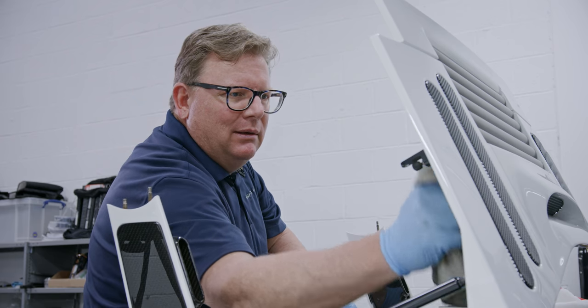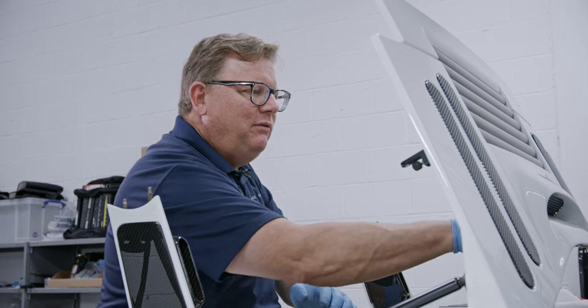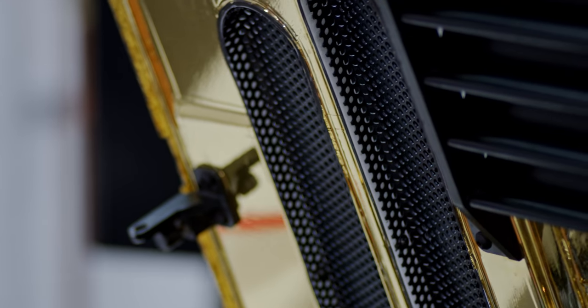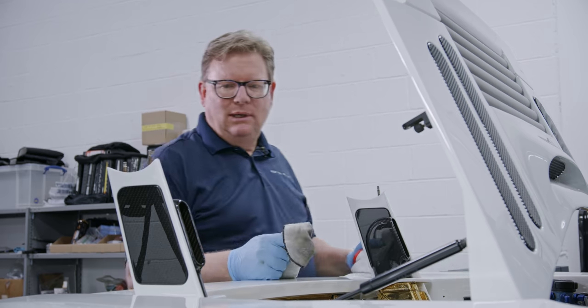The screens themselves are anodized black, so they take a different finish. You can use the metal detailer on them, but they're not painted. If you get a chip in one, it makes a very difficult thing to repair. I've got a special formulated lacquer paint I can use for touch-up — they actually fade to sort of a dark blue color and it matches pretty closely. And no, you cannot use a Sharpie. Let me prep the material to do the gold and we should be good to go.